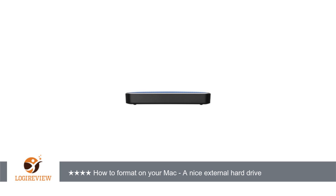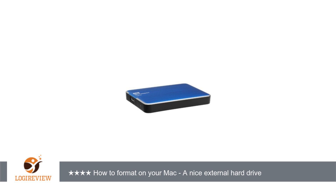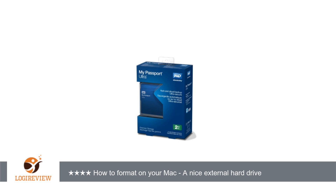If you're a Mac user, setting this hard drive up with your computer is super easy. Follow these steps: 1. Plug in the drive. 2. Open up Disk Utility, found in your Applications folder inside the Utilities folder. 3. Select the newly plugged-in drive, and on the right-hand side you should see Partition — click on that. 4. Inside that screen, on the Partition Layout dropdown, choose how many partitions you'd like to set up. I generally go with one partition and just use folders to organize my files. 5. On the right-hand side you can name the partitions and select the format.